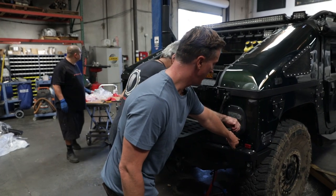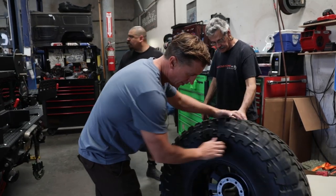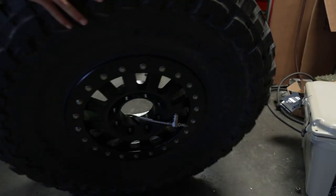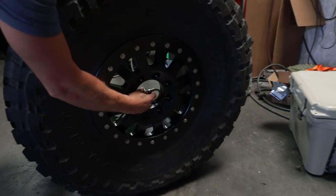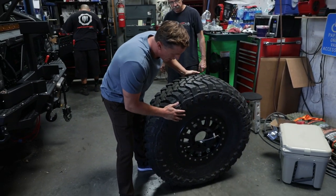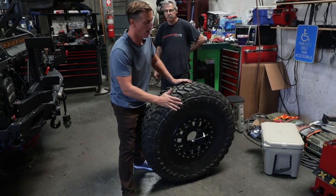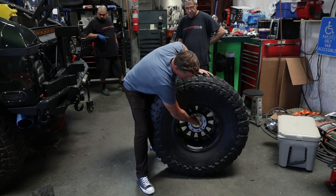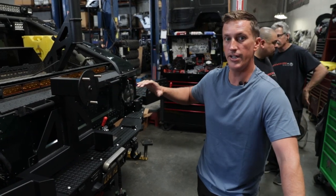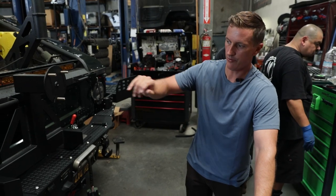We're about to install Mel's spare tire. Check out how the CTIS line runs — there's no exposed CTIS line shown here. This guy's going to wrap around on the inside with a cap on there. The advantage is you don't have an exposed CTIS line across here that you could potentially rip off in an off-roading situation. The downside is it's an H1 Hummer and it looks really cool with the exposed CTIS line. The CTIS line comes in through here and mounts onto the carrier with a spindle mount, giving him a complete spare tire with CTIS line setup — if he has a CTIS leak he's got a whole setup ready to go.